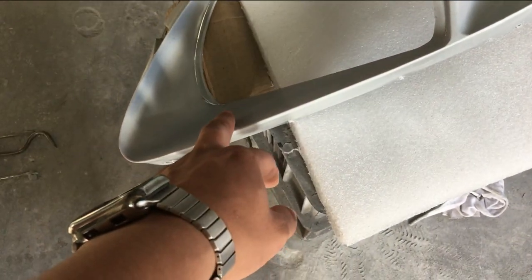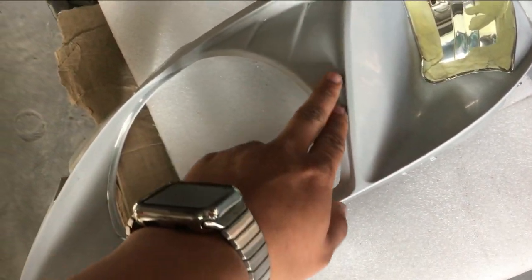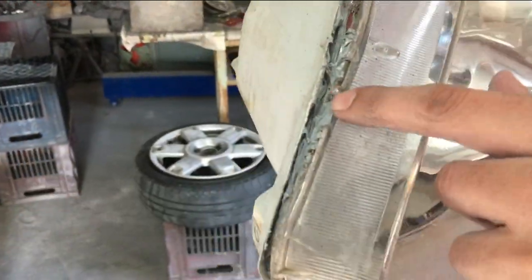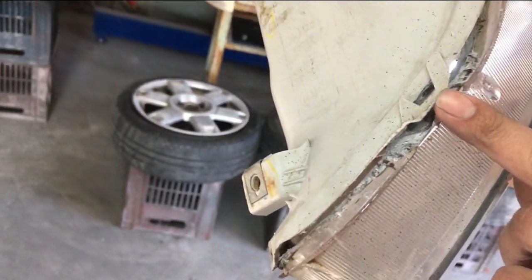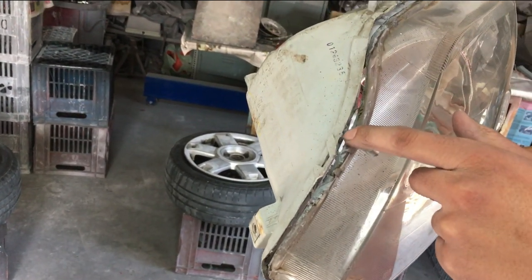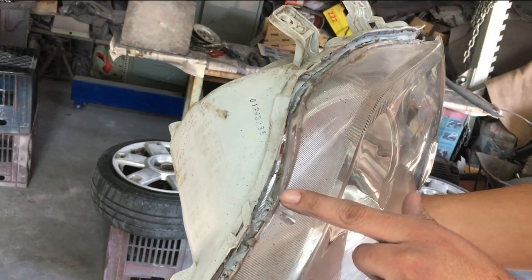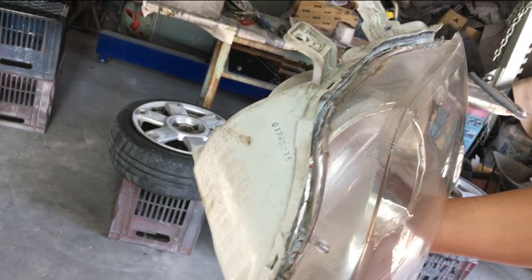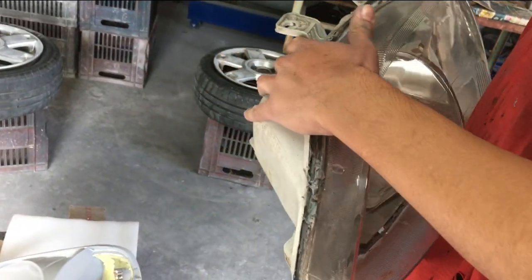So you basically sand it down. Yes. Why doesn't it look so smooth? Did you sand this? Yes. And this is how it's supposed to be. So what is this now? Basically, you see these little tabs over here? You warm it up with a heat gun. You lift it up. Then you can run a screwdriver all along the edges while heating it up, of course. Not too much, because then you melt the plastic. Lift all of these tabs up, and then you can just pry the lens off. Oh, cool. See? And then that comes off basically.